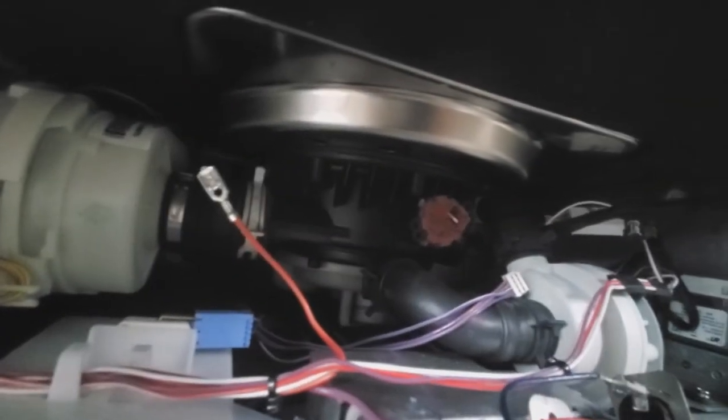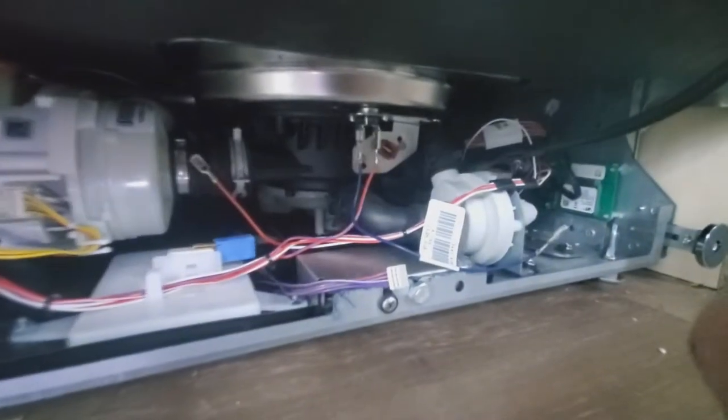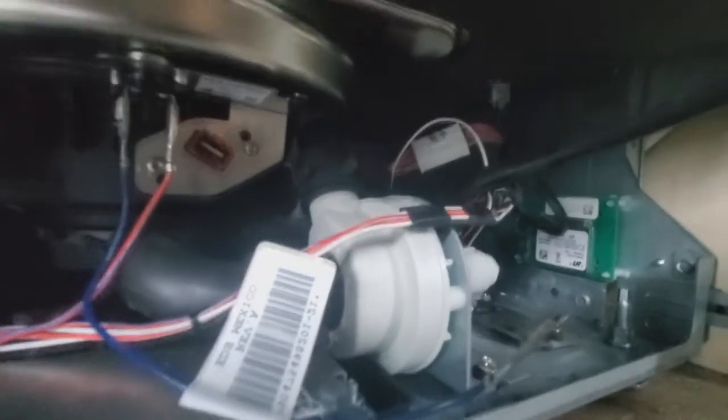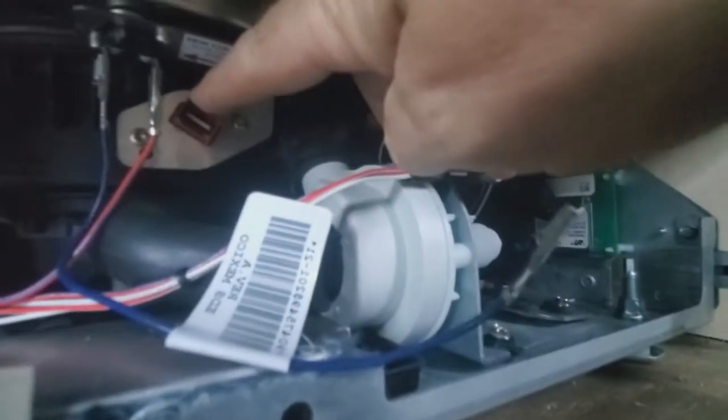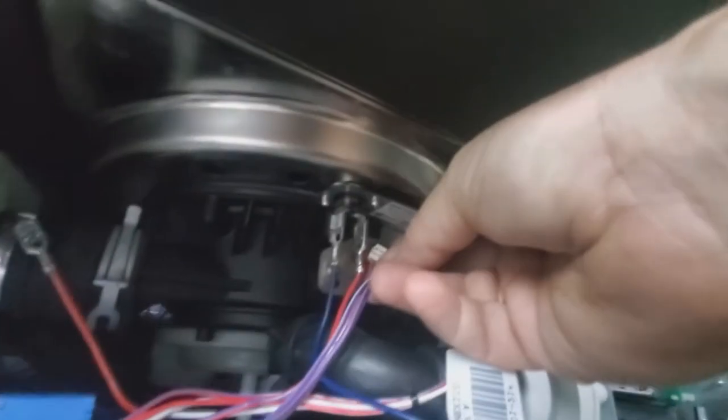With the element out of the way and the legs clear, I'm going to take advantage of the open space to get my hands in there and install the mounting bracket. I've got that bracket screwed on with the T20s. I used a screw gun to take it apart, but I recommend putting it back together by hand with a handheld Torx bit — they're going into a plastic housing and you don't want to strip them. This bracket fits perfectly over the square connector for your sensor, and now you plug the sensor back in.